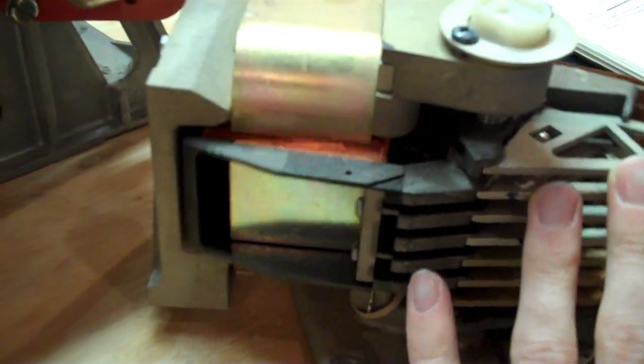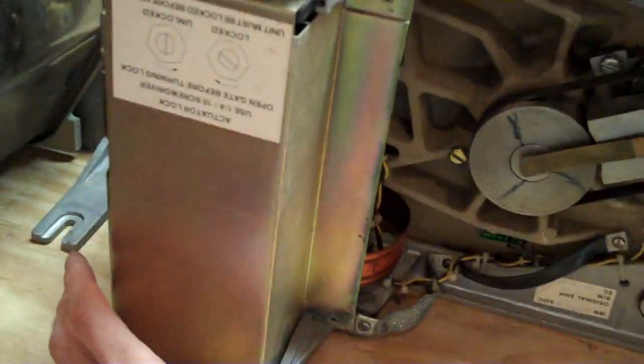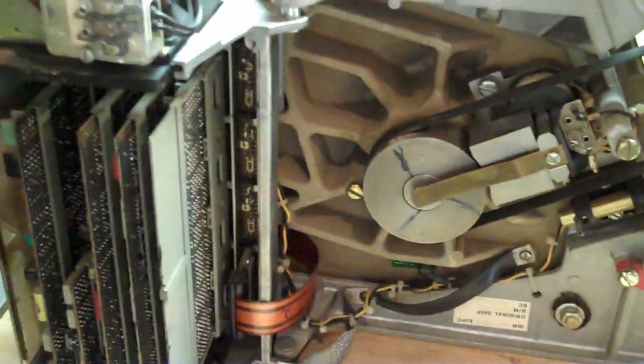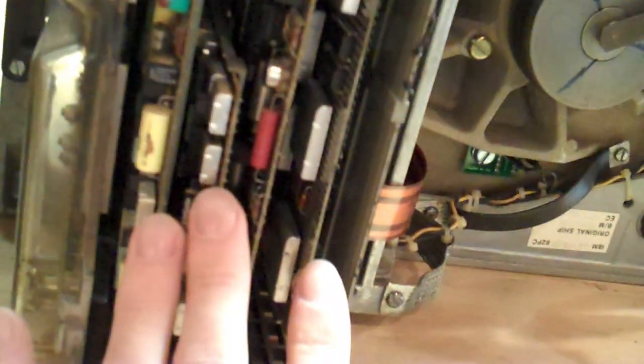There's a huge big voice coil on a permanent magnet, and I've stripped the back of this drive down a bit. I nearly dropped the head drive there. So we have what's called the logic gate and the card cage, and I see there were some cards here that I didn't recognize. I haven't actually looked inside one of these in a while, and these look awfully familiar, so I suspect that I have some spare parts for the controller on the drive.